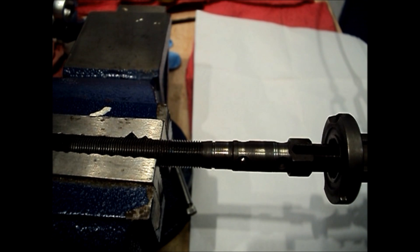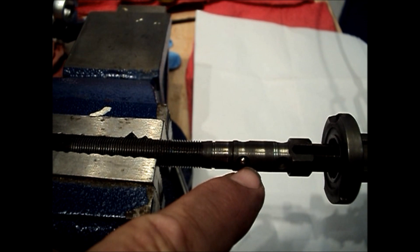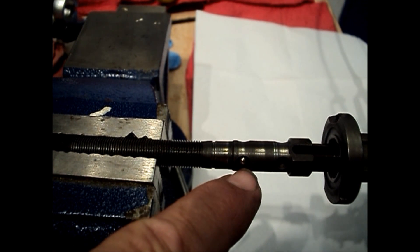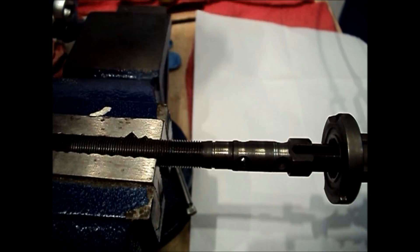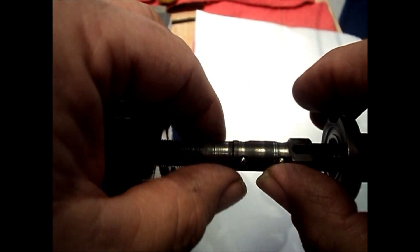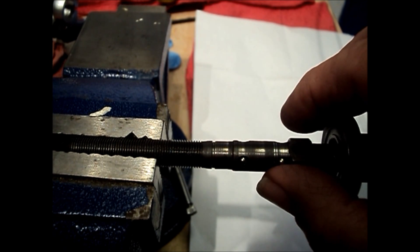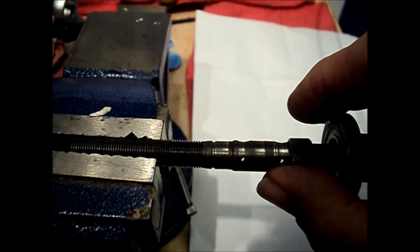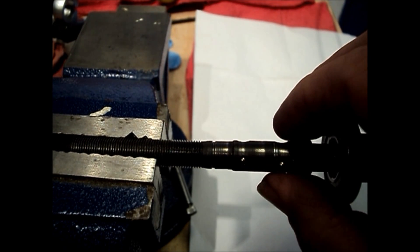In this particular instance, I have the shifter in the first gear position. This bearing ball is in the smaller of the sun gears and it is recessed in the axle. This bearing ball corresponds with the larger of the sun gears and it is in the out position, so it has the larger of the sun gears engaged to the axle and therefore that sun gear is non-rotating.